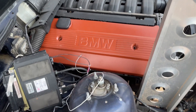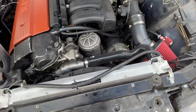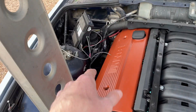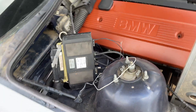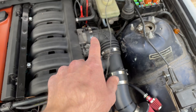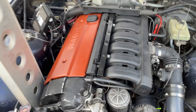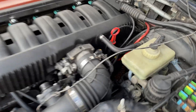I'm going to have him order some hardware - the copper lock nuts for the headers so you can actually get them off when they heat cycle - and then plug all the rest of that stuff back in. I'm also going to try to fire up the car and connect to this Megasquirt to see what kind of tune is on it. For speed density, your manifold pressure sensor and air intake temp sensor have to read correctly, so I want to get a baseline and see what everything's reading without even firing up the car yet.